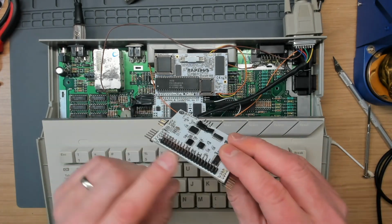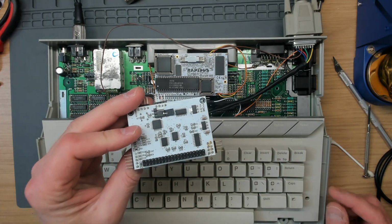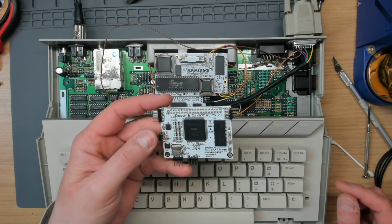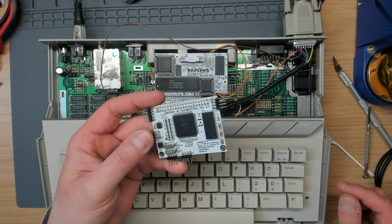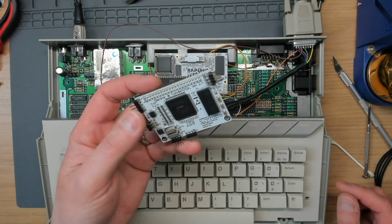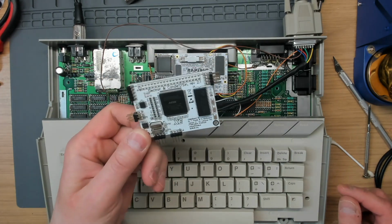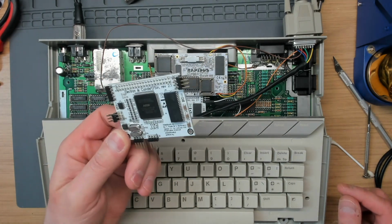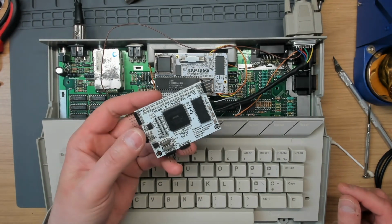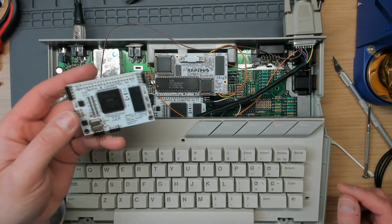It's brand new. It's got the different connector on the back there. The revised one has male pins on it now, so I'll put that in this machine, and the machine doesn't even boot. There's no lights come on or anything. So it looks like I've got another dead VBXE. So that might be a potential RMA. I don't know if I can send that back to Retro Lemon for quickness or what. I'm going to test it in another machine anyway that's known to work. But I don't know why it wouldn't work in this machine, because this one works in this machine.